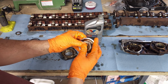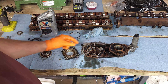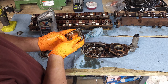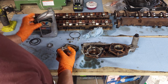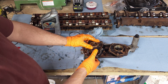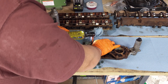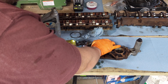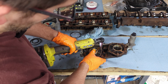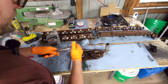The outer one went a lot easier than the inner. Wipe out the inside of this - spring is going to go in with the larger part pointing down. I left the gasket on this one, I wiped it off so it should be fine. Lubricate this again, right back on over this, compress that spring - it's pretty tight - get a bolt started. Torque specs from the internet that I can find on this were 10 newton meters for these four bolts.